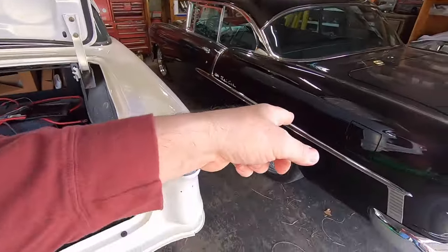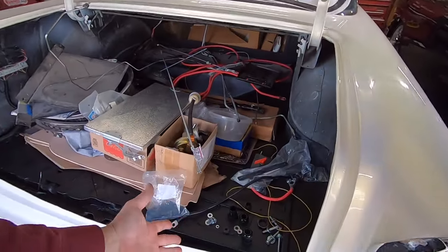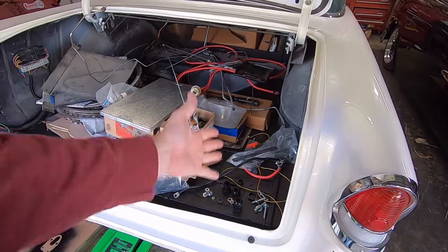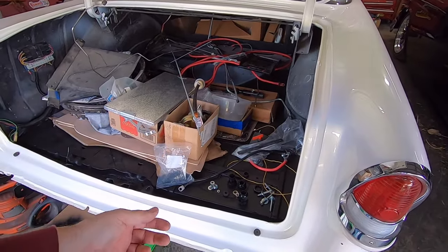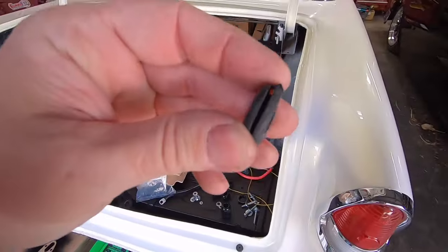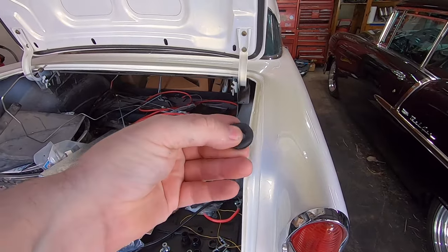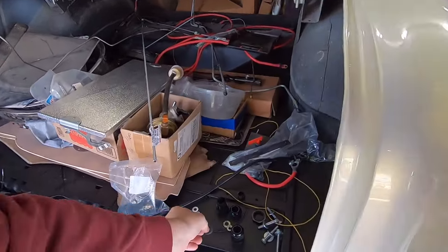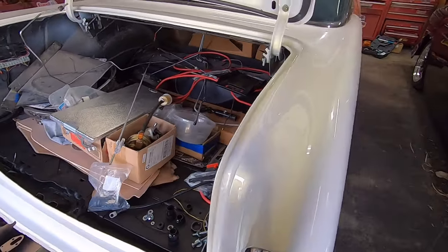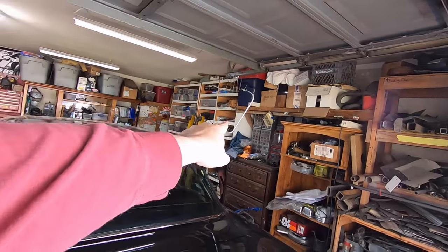I used these on my hard top about five or six years ago and they're just really neat pieces. It gives me peace of mind having a positive battery cable in a trunk-mount application going through a trunk floor with just a thin rubber grommet — you can imagine how thin that rubber is between the inside edge and where the cable goes through. I just don't have any faith in that for a positive battery cable.